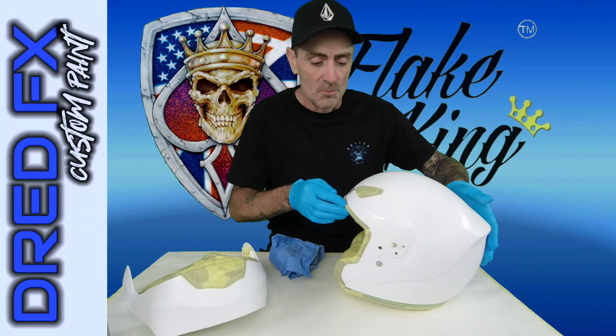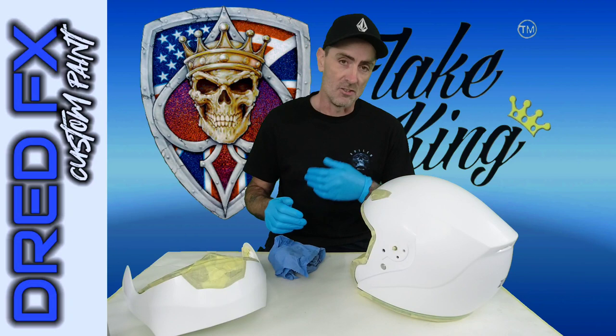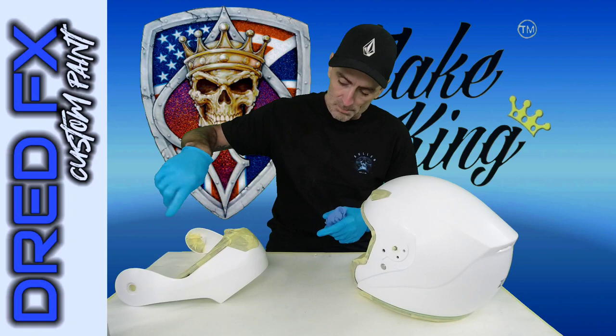Just have a good look round and check where your masking tape and your fine line is, and make sure you've not pulled any away as you've been Scotch-Briting. So the next stage on this is to clean it. I would give this a blow down with an air blower, get all the bits off, and then you're good to go for cleaning.